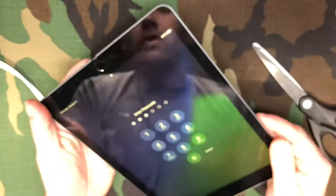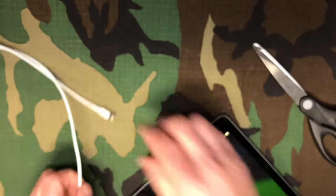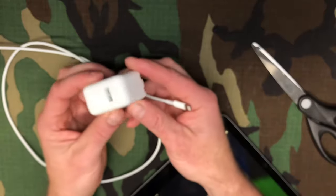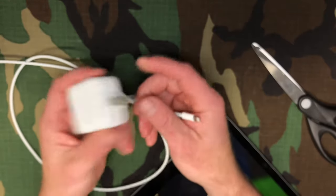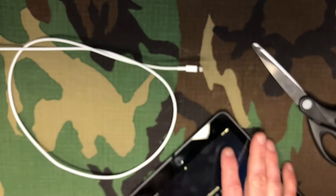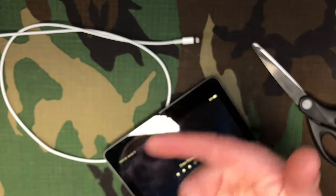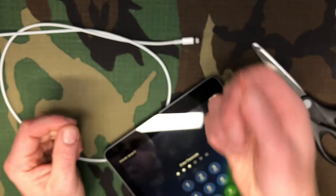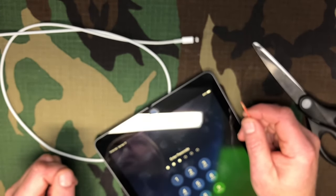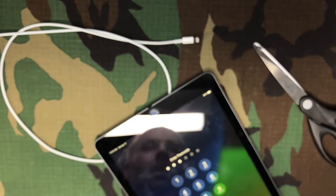If this doesn't work, it could be your battery or the charging port itself that needs replacing. But before you go there, inspect your cable and make sure it looks good, check your battery pack and test it with another device. If those things work, then move on to the next steps. The same idea applies to iPhones and Samsung phones — check for lint first with a toothpick, and then try the tape fix. I hope this is helpful! Thanks for watching. If you have any questions let me know, please subscribe, give a thumbs up, and check me out for more videos.